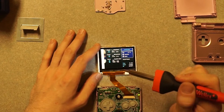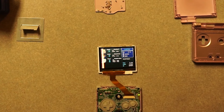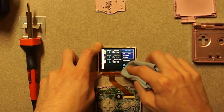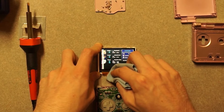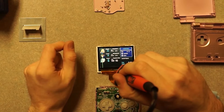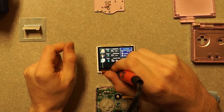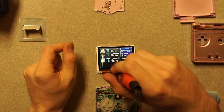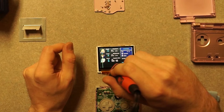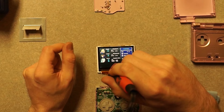After a while of applying the soldering iron, I noticed that it was really malleable. I was seeing the lines were turning white and coming back relatively quickly, so that means that the solder was beginning to flow properly. With that heat still in there, I used a soft cloth and just kind of padded the ribbon cable. After doing this a few times, I got down to just one line and applied that soldering iron. And there you have it — it looks like that solder has been reflowed.